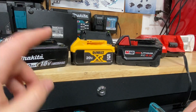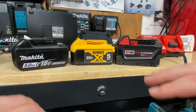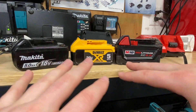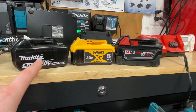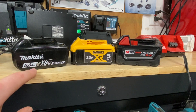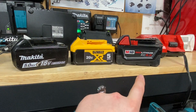I don't mind using Makita on their rapid chargers because some rapid chargers — every brand actually has one — have a fan built in to control the thermal load of that battery. By keeping that battery cooler while charging, it's going to help prolong battery life. I looked into recommendations from DeWalt, Milwaukee, and Makita, and a lot of what I saw recommended was to charge when the battery is about halfway down — don't let it go all the way down to zero. There's actually a Makita battery reader that tells you the number of charges, the number of times it's been over-discharged, and cell health as well. By running these batteries down too low, you can damage the battery; discharging too quickly or charging too fast can also cause battery damage.